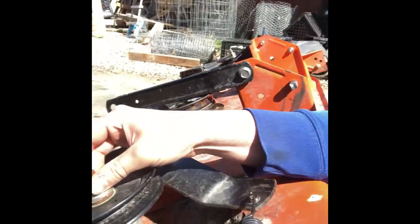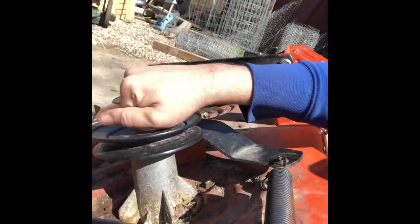If you try this with an air wrench or power drill with sockets, be careful. When you crank that nut over and try to get it to come loose, it will free spin in reverse. So if your feet and hands are under there and you take off with a drill or an air wrench, you might be missing a digit if you're not prepared. I'm not against using those things,